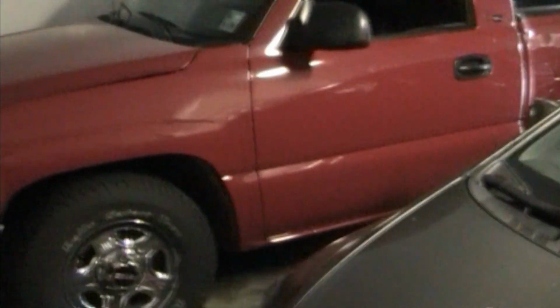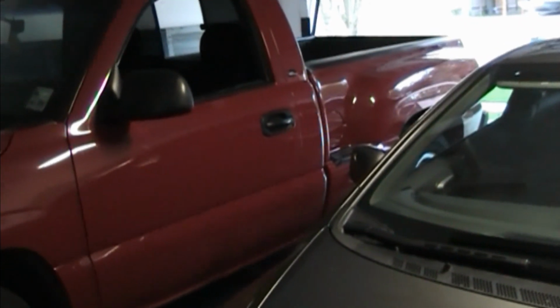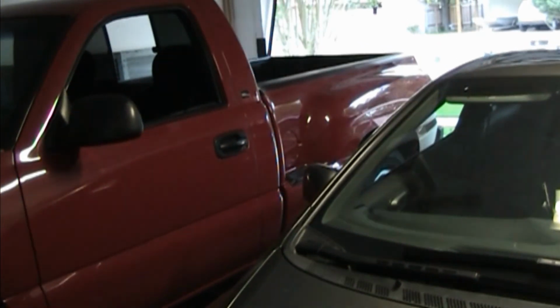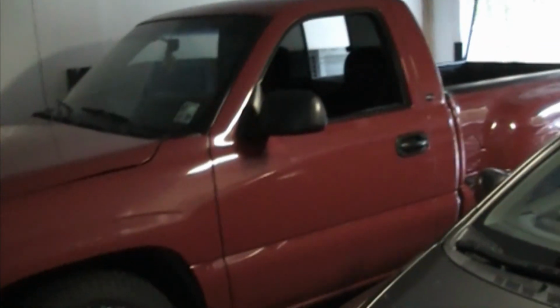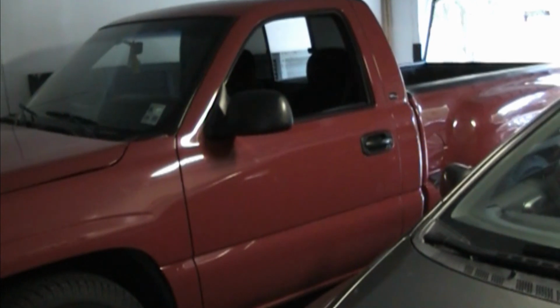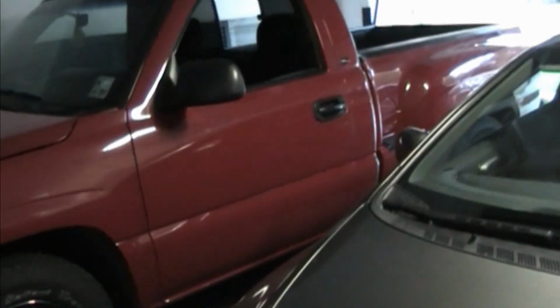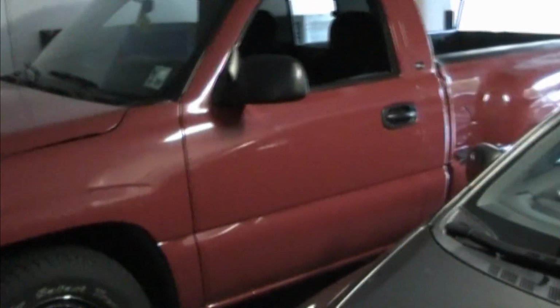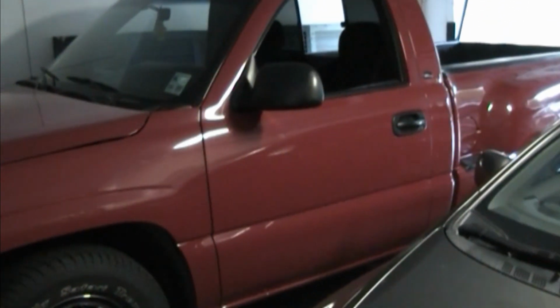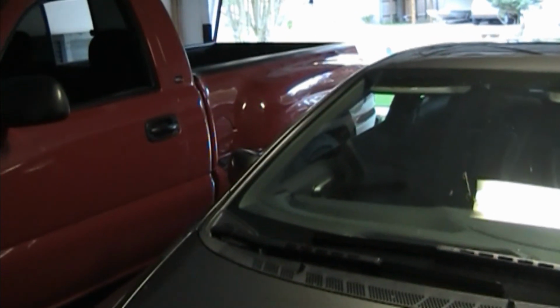And a lot of people say, you know, with the V6 you're really gonna wanna concentrate. It doesn't push that much air through, basically. So what you wanna do is concentrate all the air into one muffler and then dump it. Most people will run a Flowmaster Outlaw muffler, which is basically like a glass pack but with no glass in it. And they'll just dump it right there after the muffler under the bed, which, I mean, it sounds good. It's the closest your truck is gonna sound to a V8, especially at idle. But you don't get that cool factor of the two pipes sticking out the back end.